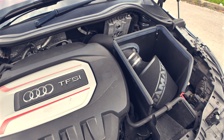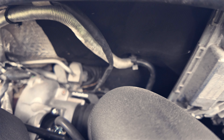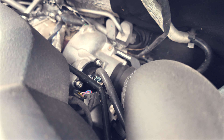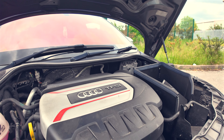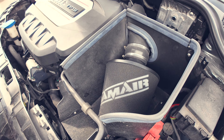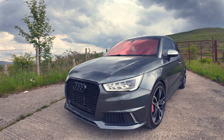Now on to some power modifications. We've got the Ram Air open air filter — it comes with a heat shield, a hard pipe, and a turbo elbow. This is very cost effective but it is an open filter unfortunately. It's paired up with an IS38 turbo from a Cupra, a Turbosmart blow-off valve, and an upgraded high pressure fuel pump. The higher and lower injectors have been changed for Golf R injectors. The S1 made a healthy 400 BHP and was tuned by Devil Developments. The intercooler is Atec's biggest intercooler — it replaces the crash bar, also known as the stage 2 intercooler.